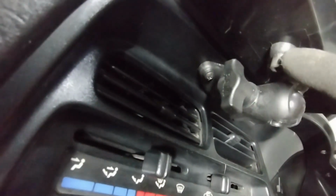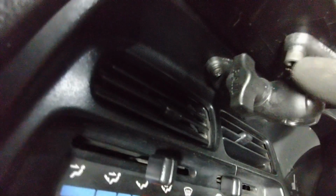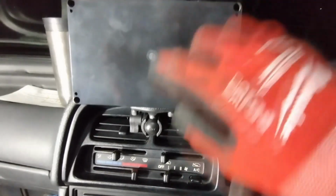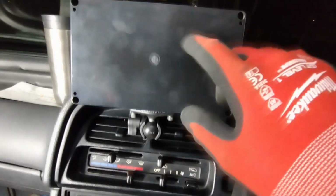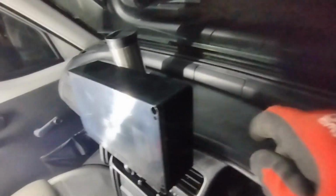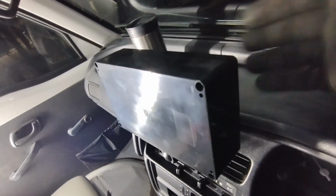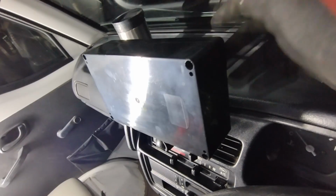For here, I wound up enlarging the holes and using 1/4 cap head screws. I think they look nicer with this fit. And inside of this project box, it's just a fender washer with a nylon lock nut on the inside. The idea behind here, you're actually looking at the rear of the box. This box is roughly 7 inches plus by close to 5 inches tall, and it's about 2 inches deep. The back 1/2 inch of this is the panel. That's actually the face you would use if this were a project box.